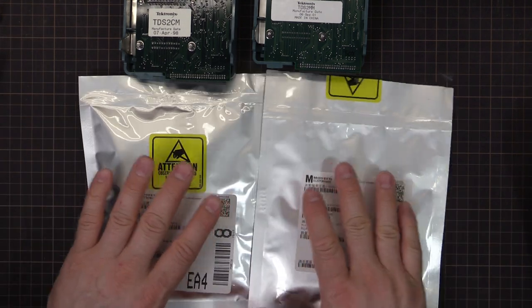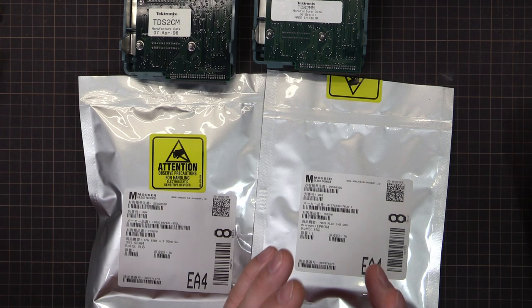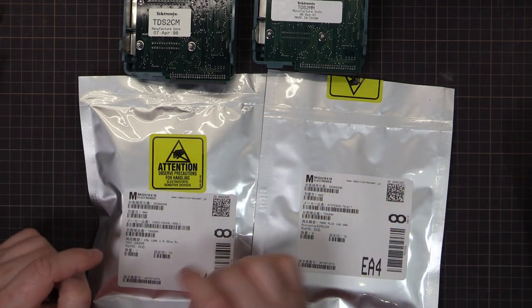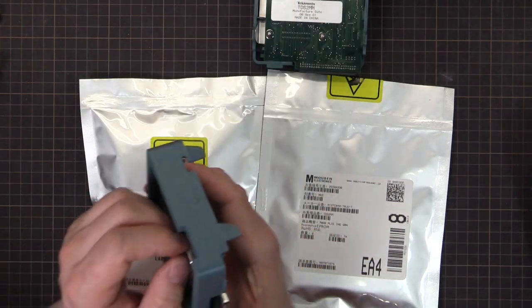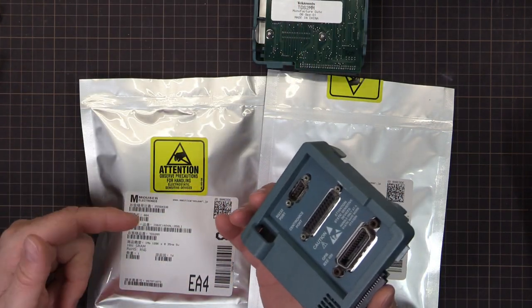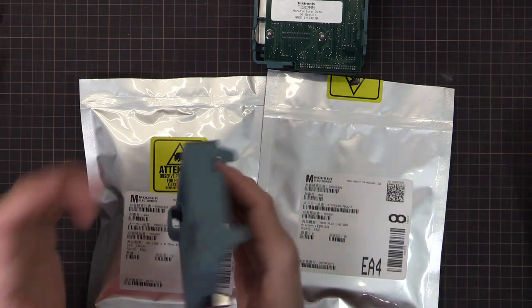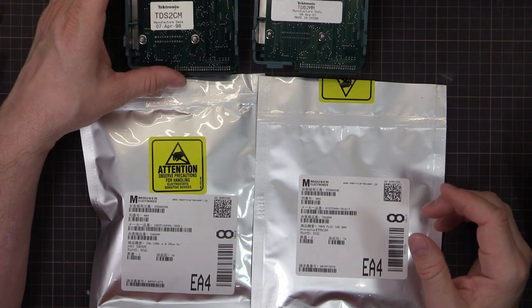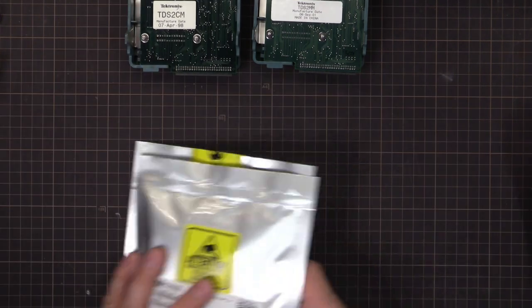Also, you need two chips. One is the new memory chip, like the new PROM chip, and you need upgraded RAM. So in here is a RAM chip. We've got to desolder that and put in a chip with more RAM. And then we've got the PROM chip, which is the one we unplug and plug the new one in. So let's get this stuff out of the way.